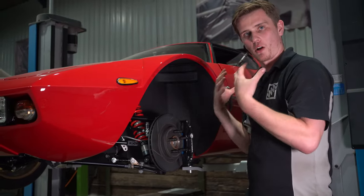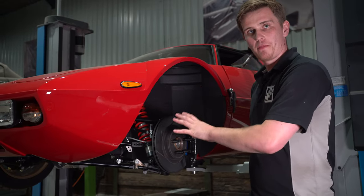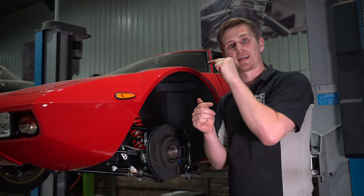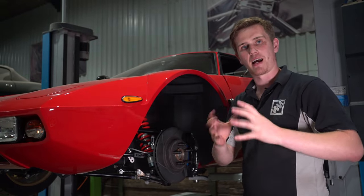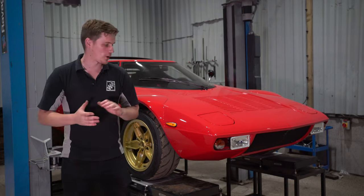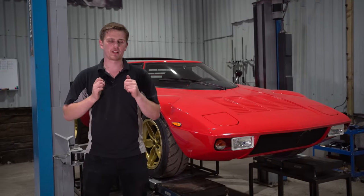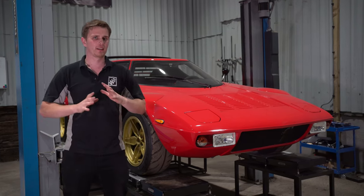Once you're happy with the corner weight and all your ride heights are set and the C-collars are locked back off, with an adjustable drop link like this car has, you put the wheels back on, put the car back on the patch with all the weight on the wheels, then reach in underneath and reconnect the anti-roll bar with the adjustable drop link set to the length where there's no tension whatsoever. That means at the corner-weighted ride height the roll bars carry zero tension and won't affect the balance in left and right hand conditions. Previously the car would have been quite loose through a left-hand corner and quite tight through a right-hand corner - very noticeable when attacking corners on track.